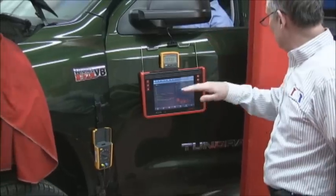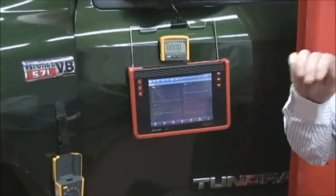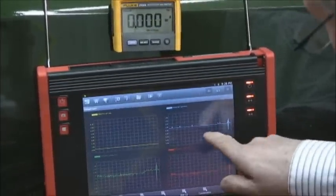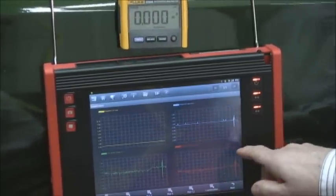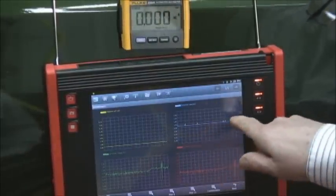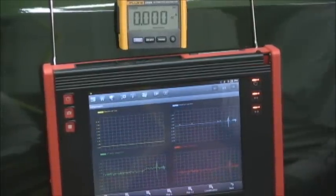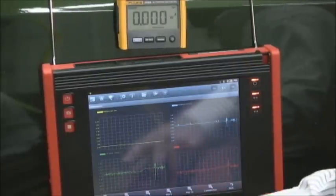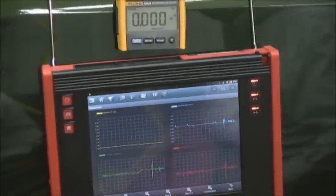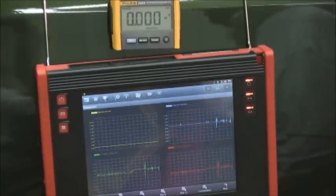Have it up to 2,000 RPM and hold it for a little bit. So now we're going to race it up — not like flooring it, but more like a high idle. It works a little bit, but what you'll see is it'll steady out the current. It's a lot more steady signal than before because it's not constantly asking for enrichment and then leaning it out. It's a much more easy signal all the way across. We're mostly looking at the green screen on the bottom — that's the voltage — and the red screen, which indicates the current it's reading to get that mixture. The meter is staying at zero.